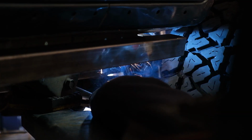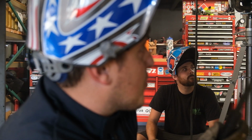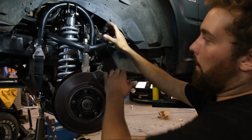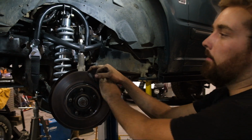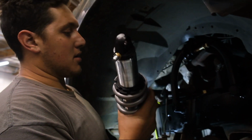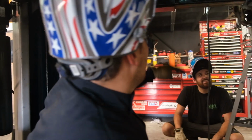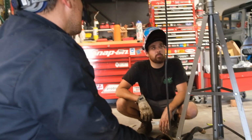Something like that. So we're doing rock sliders. We have new lower control arms that were just replacement stock. The uppers Jake made a jig for, and then made uniball uppers for that are all adjustable heimed. What else? We have shock hoops, Fox 2.5 or 2.0? 2.0, yeah. We're not balling yet. So it's gonna be thick. This has all happened in the last 3 days.